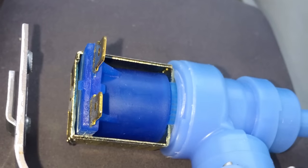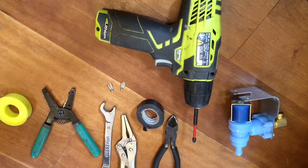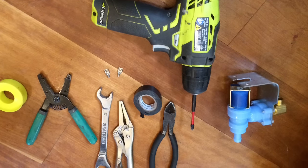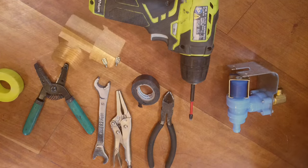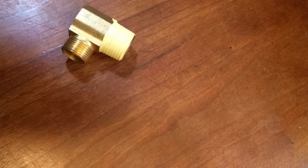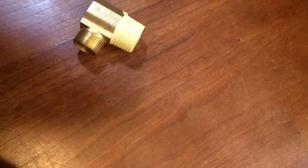Here's the old valve beneath the sink — it should have a little bit of vibration. This is what the new valve looks like; it's a simple generic one used on most dishwashers and very effective. Take the teflon pipe tape and wrap it around the larger of the two threaded parts of the elbow — the bigger threaded part is the part that will be pushed into the female threads on the new water valve.